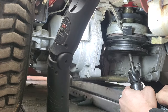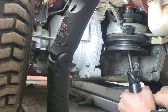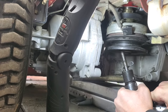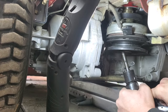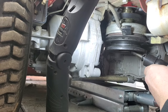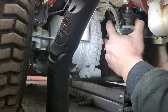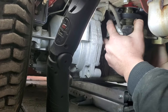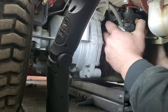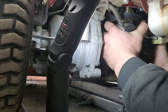Either way, it's going to kind of just get that stuff to go down along the shaft and have the clutch come off. See how it slid just a little bit there? I'm just pulling slightly, but it just got that lube right down in there. So it was able to come off — it's moved at this point, which means that lube's in there working.